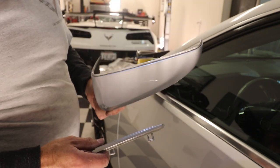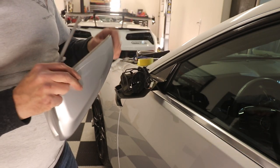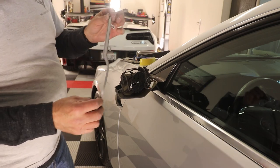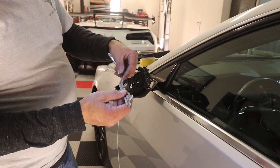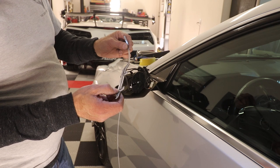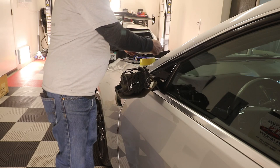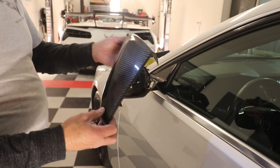You can get these covers from GM and they're paint-to-match, so you'd have to have it painted again if you ever needed them — be careful in case you want to change back to the original. Also, this little chrome trim piece has a part number, but from what I understand you can't get this one particular part without buying the whole mirror assembly. This one is part number 780025 and it says left hand. Anyway, just be very careful with it.